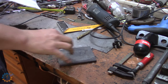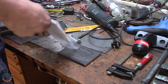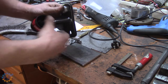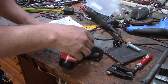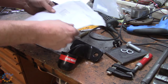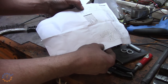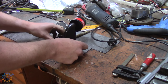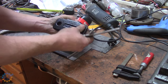We have this plate here, it's 8 millimeters thick, and it's good enough for this type. 2 M16 bolts will fit in through here, and they are rather long. Lock washers as well, of course. And it even says here 350 to 420 millimeters height to the middle of it. I think we should be able to manage that. 90. And we're going to mount it in the top, because then we have space to raise it up and down. Measure the hole.